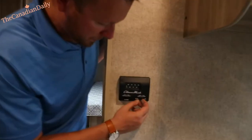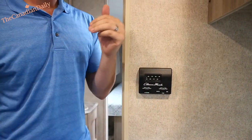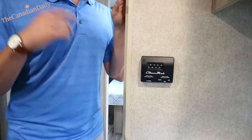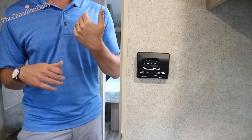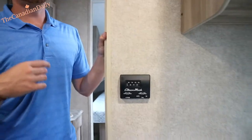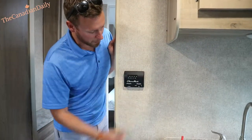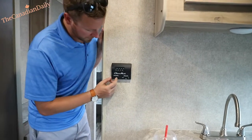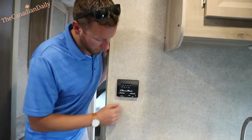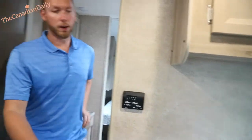I like to keep the fan on auto — usually auto high or auto low — and it'll ramp up and down, shut itself off and come back on like a heat pump or forced air furnace. If you keep it on fan-on mode, it'll continuously blow even though the cooling mechanism cuts out. We get a lot of calls when people don't understand that — the AC has reached temperature, it's the blower that continues. Auto mode just works better. For the heat, you've got a simple fan to exchange air, then off, then heat mode where you turn the thermostat up.